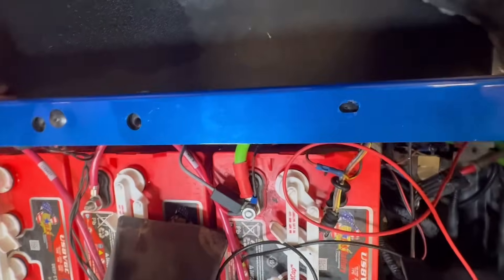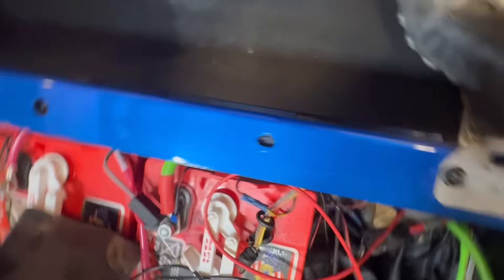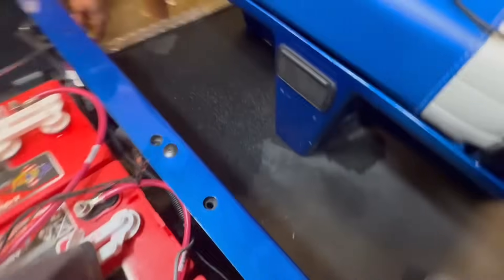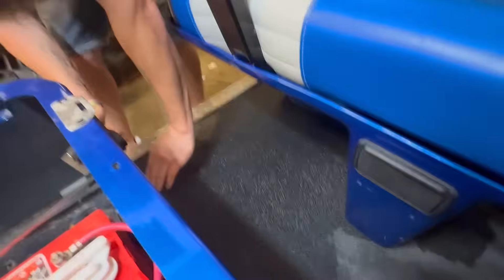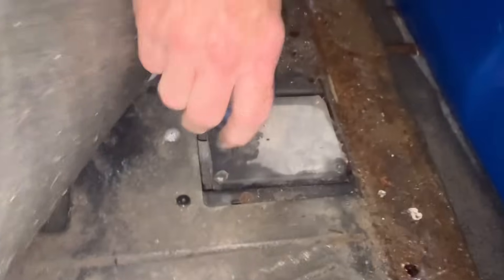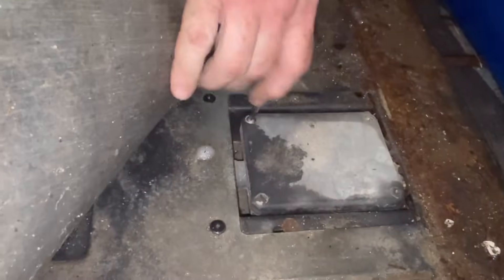Now here's what we're going to do — we're going to pull the throttle up. Pull this up; that's going to be our throttle. We're going to see exactly what's going on right there. All right, so it's got to be up here. This is your throttle box. You can see you've got your ITS — it's got four screws, but on this one it's got two screws. If you have an older style EZGO, you're going to have four screws.